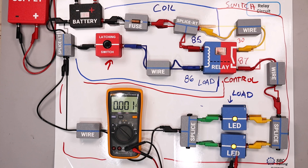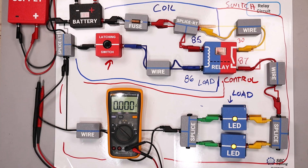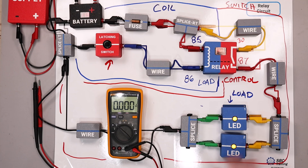If the load is not dropping correctly, we're going to look at the ground side and the power side. I created this circuit to help students understand how to correctly diagnose electrical problems. Any of these nodes — except the fuse — I can set a fault in, including the relay. That fault can be utilized to quickly test your knowledge and experience in diagnosing. I'm going to pause the video, set a fault, and then we'll come back and see if we can figure out where the fault is.